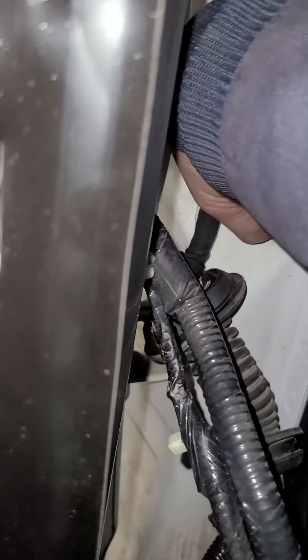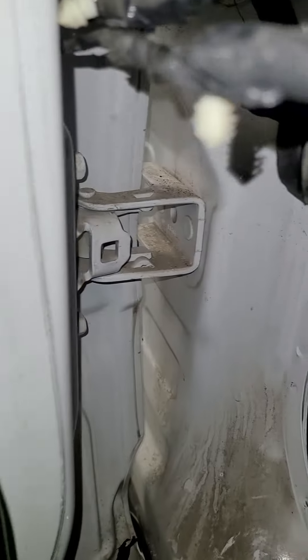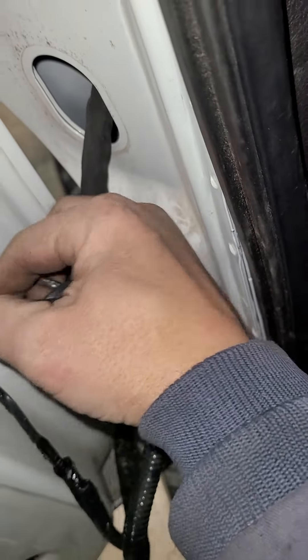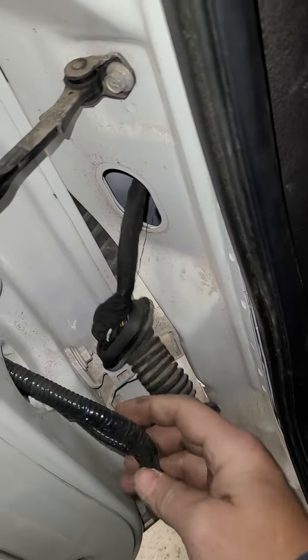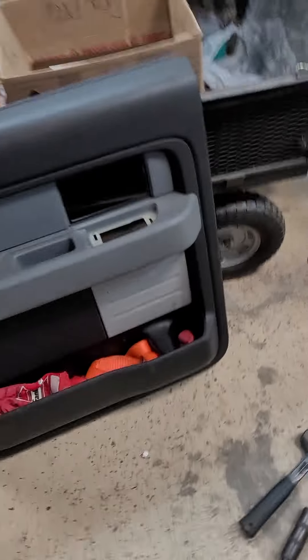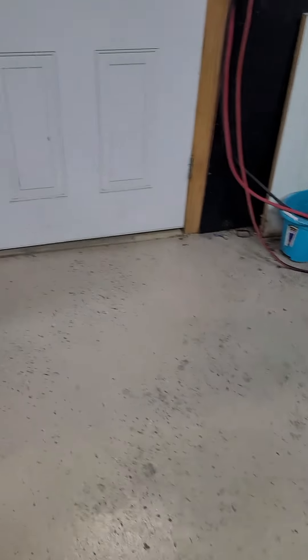However, from what I'm looking at here, this harness is not what everybody says it is. Supposedly there's a plug right here, but there is no plug in this truck on either side — I've looked. It's a backup in here and the harness goes up in here somewhere; there's no little plug right there. I don't know what everybody's talking about that I've seen on every one of these videos. The Ford part called a jumper harness that they show doesn't look anything like this — go figure.